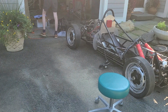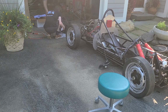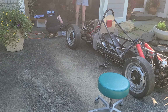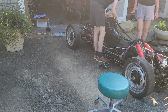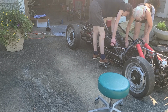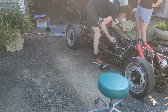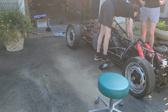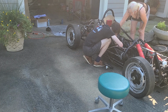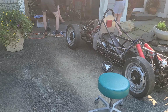So now what you're seeing is us taking a turkey cutter, for lack of a better word, that does come with the kit as well from HMS Motorsport, to cut off those end pieces or those bulbous pieces that kind of spread out into the roll bar. As you see while we're test fitting it, we still can't even get it to seat properly because of those bars. We're just using sewing chalk to mark the areas that we're going to cut, and then going back with the cutter, cutting it off, placing the seat back in, and then repeating over and over again until we have the seat at the final trimming size that we need.